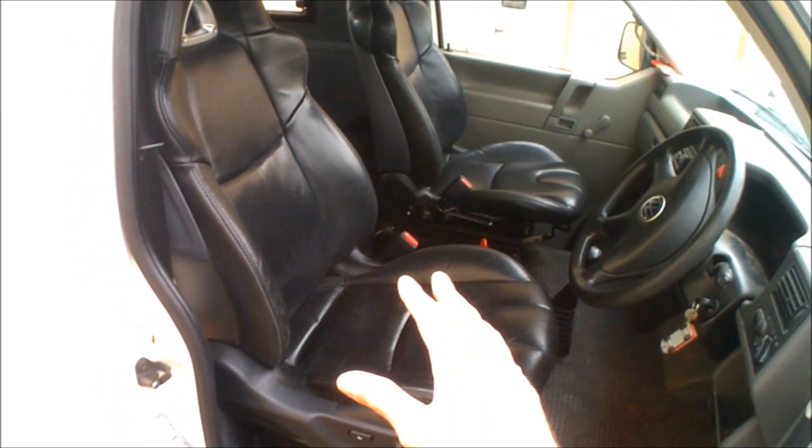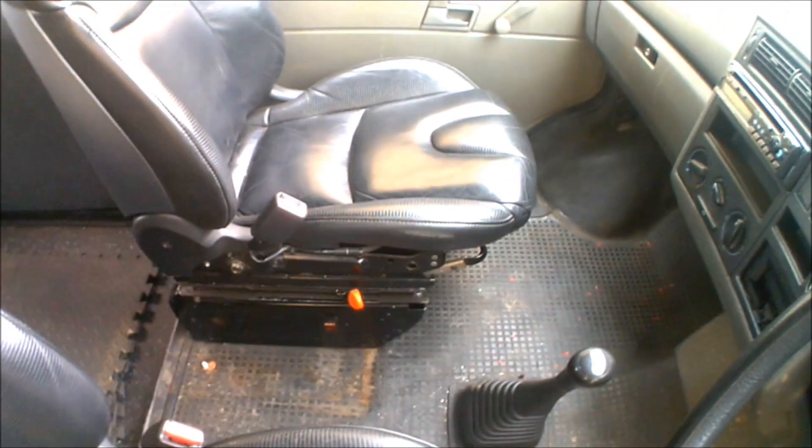As soon as you turn the ignition on, all the seats work fine. For the heated seats, because they're on illuminated switches, you can tell when they're turned on or off. So that's everything working — everything fully operational: all the seat motion, all the backrests, lumbar support, and the heated seats. So there we go — that is my RX8 seats fully fitted into my VW T4 with all the electrics wired up, heated seat function included, all to a switch relay meaning it can't just drain the battery. When you take the keys out there is no more function to the seat because the relay is now turned off.